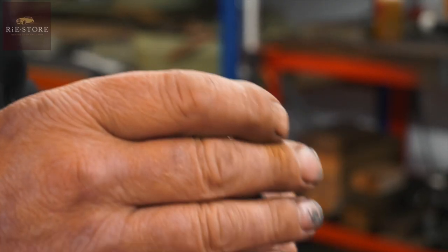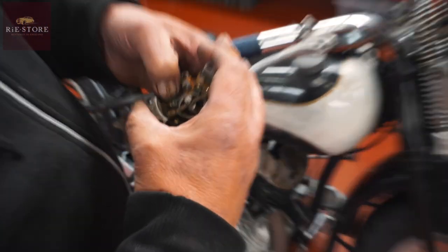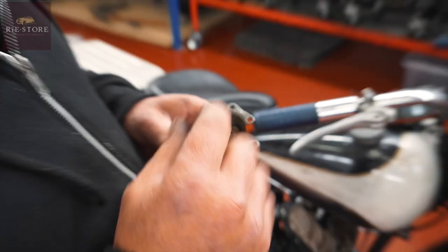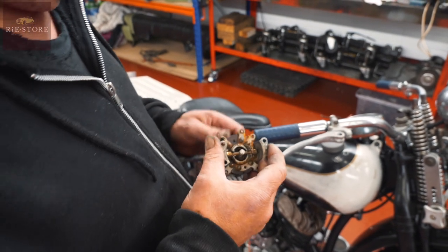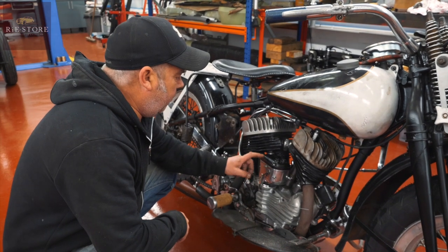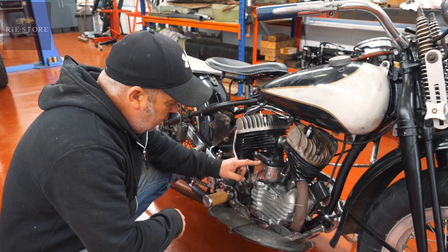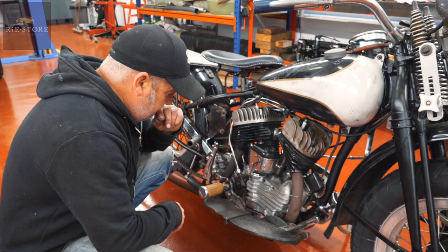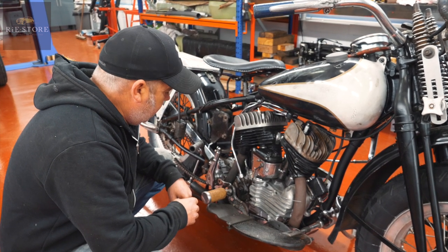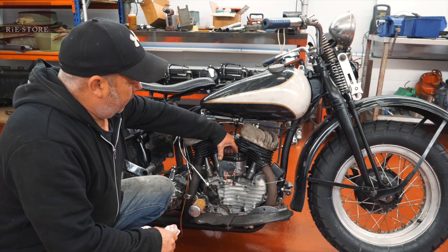I'm going to have to look at a wiring diagram, but that per se is a spare contact. I'm not sure if you can drill into it — everything's powered up separately, you can't have power going through that terminal. You might just have to put a toggle switch on it. I'm thinking maybe you could split that wire because that's a feed from the generator side to the coil — but no, you'd still be putting live through it, you can't do that. It's a case of sitting down and thinking it through, but we'll get there. Might just have to have a toggle switch hidden somewhere.